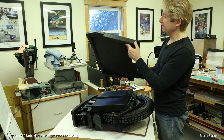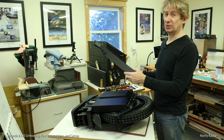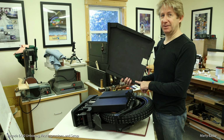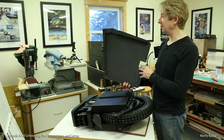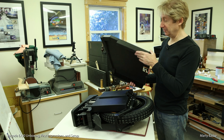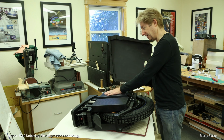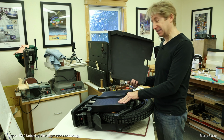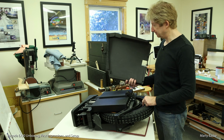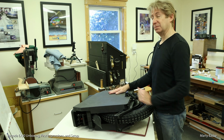And then the indoor-outdoor carpet tape, which I use, I'll put a link in the description if you're interested, works exceptionally well with this foam. I always clean the foam surfaces with lacquer thinner first. Let it dry for a minute, apply the tape, and if you try and remove this, it'll tear the foam. So it's really nicely done. All I have to do now is clean the battery packs with, again, lacquer thinner. I'm going to put the industrial strength Velcro on these battery packs. That seems to hold okay. Put Velcro here, and this side will be complete.